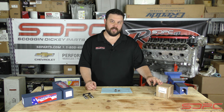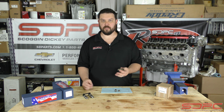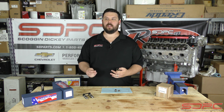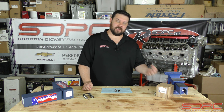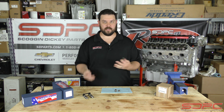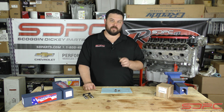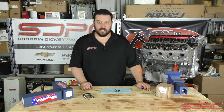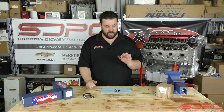One of the biggest misconceptions with the LS7 lifter is that it only came in LS7 engines and that none of the other LS or LT engines' normal roller lifters are anything but subpar. That's not the case. These were nicknamed the LS7 lifter because that's what these lifters debuted in, and that was the big dog at the time — a 7-liter engine, over 500 horsepower, 7,000 RPM. It was a track monster. Us hot rodders like to nickname things and give them a little slang. By the time 2007–2008 came around, the LS7 lifter became the standard service lifter in everything from 4.8, 5.3, 6-liter trucks, 6.2 trucks, LS3s, and they even put them in some of the LS2s. It's been the standard since, and they are still using these in the LT engines on their non-DOD lifters. So yes, even the V6 engine got it.